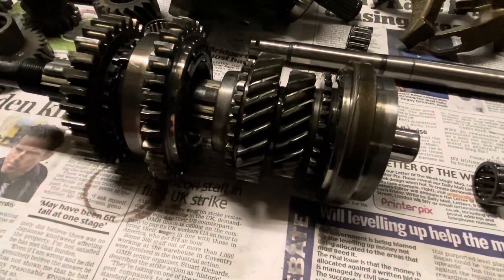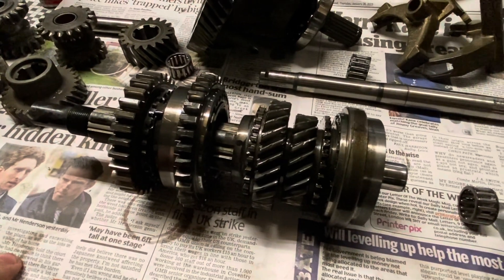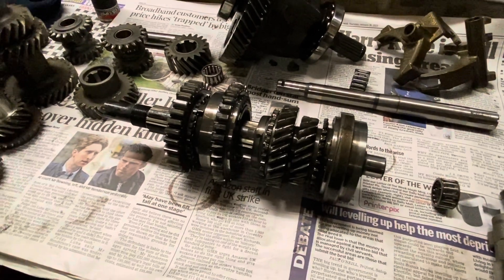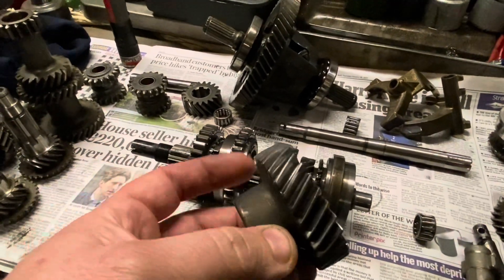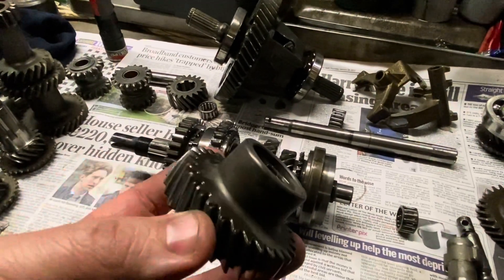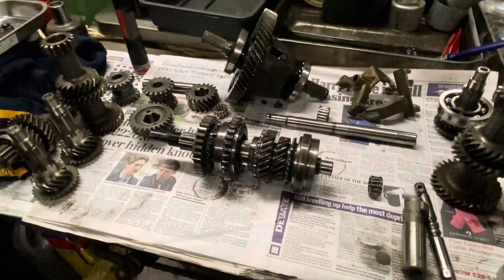Together with that, because we're building a torque pump, this single ring gear set with the standard ratios isn't actually the best application. So what we're thinking of doing is changing it for the twin ring gear set with the wide 4-to-1 ratio first gear. That basically means there's a bigger rev drop between the gears. But because we're building a big old torque pump, this engine's going to have plenty of torque to pull that with a 2.9 final drive. We've even discussed going to 2.85-to-1 by putting on a 28-tooth economy input instead of the standard 29-tooth, but we think that's over the top. So we're going to use the standard input — 2.95 with a twin ring gear set.